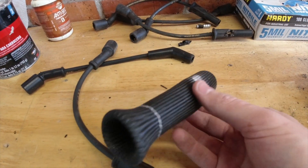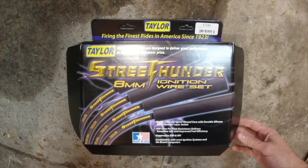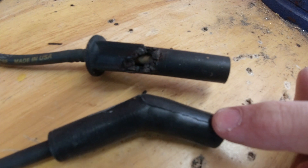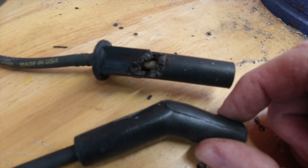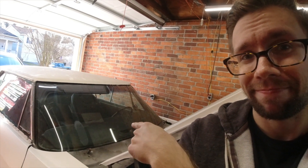They were both sitting tight on the header — you have to pull the sleeve and you can hear it grind against the header. Contestant number three has its own special place because I've been running a second consecutive test on a different design of spark plug wire: an angled boot. I found this is also cheaper at O'Reilly's. You can cut about a quarter of an inch off the end and that'll slip it down away from the header — you really won't have too many issues. Now, you might start a few fires, it might explode. There's always the possibility of death by decapitation, so take that with your own science experiment in mind.